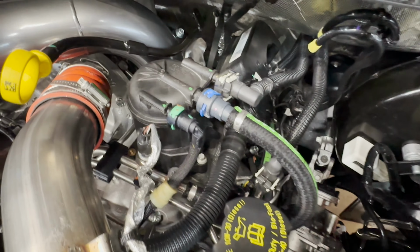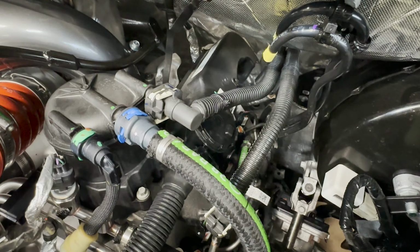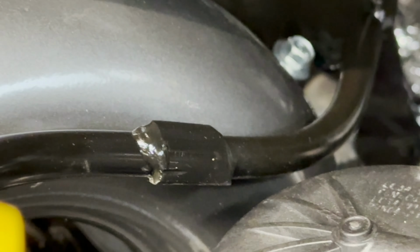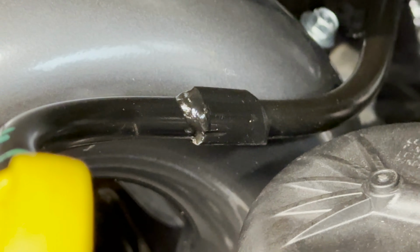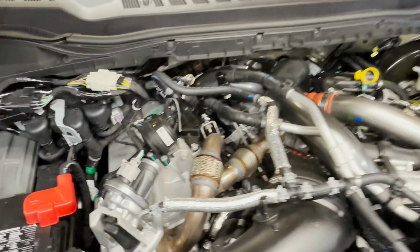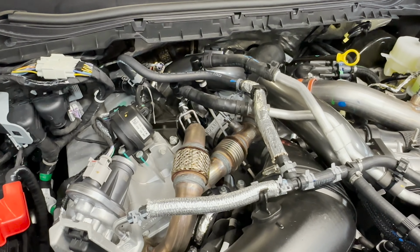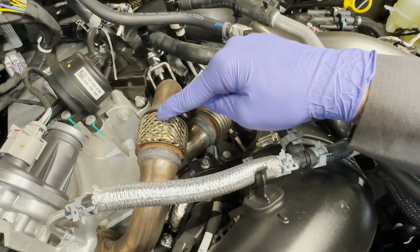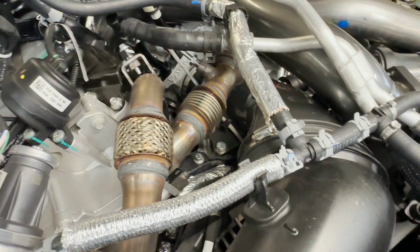Took the fuel filter out, took the fuel filter cup out. It's got the new CCV box on it, so that made it okay to work around. Doing the pusher, we did have to modify the oil dipstick tube, so cut it off pretty nice. There's no more bracket, painted it with some black spray paint. Looks real good. For the most part, that's really about it. This pipe changed. It didn't have this woven flex pipe looking stuff on it.